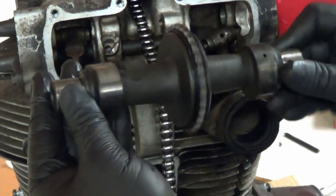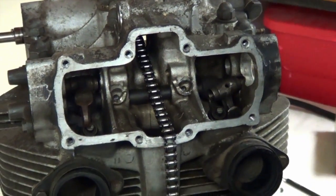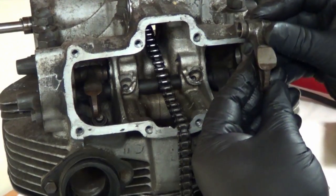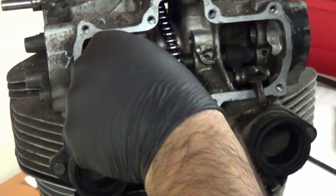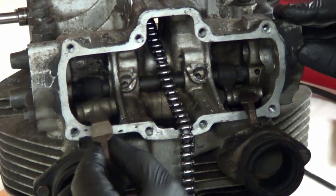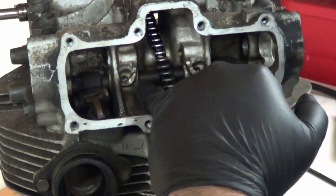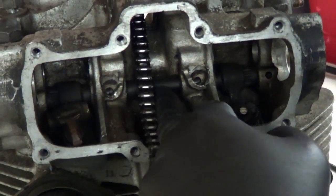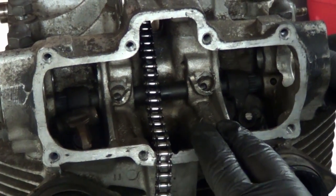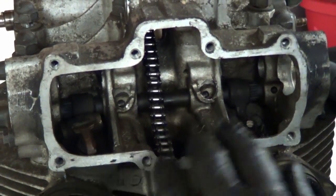There is our intake camshaft. A rocker arm that can move. A rocker arm. That side of the engine, another rocker arm. So we'll go ahead and label those and mark them so we'll put them in the correct place. And then here's our torsion bar. This bar right here — that's actually the valve spring in this motor. Totally different design that Honda used here. There's the tip of our valve and valve guide and all that stuff. It's the same thing on the other side.